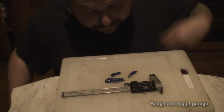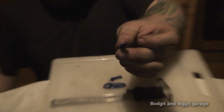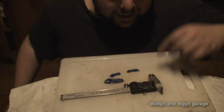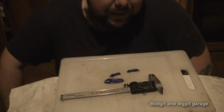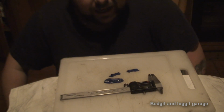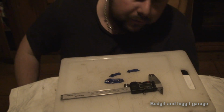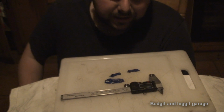Now, from what I can measure, again, I'm hoping the camera's picking this up. It's just so difficult to see, but you can see the indentation on the plasticine. And when I've measured it, we're about 1.34 mil, maybe slightly thicker, maybe 1.36, but it's looking like about 1.3 mil. Now, from memory serves, I think I should be okay up to about 1 mil. I think that's the minimum.